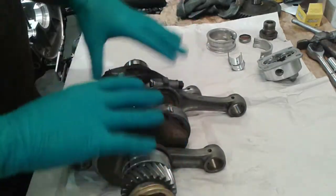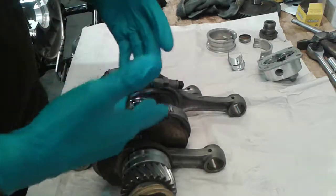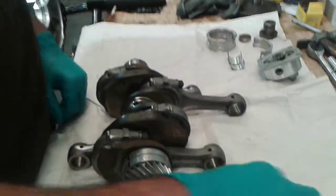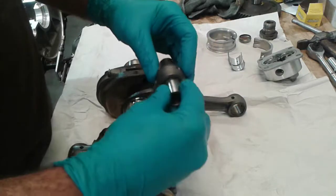After you've done all the checks, you assemble your crankshaft, put all your connecting rods in, torque them properly, and lock-tight them — in this case I did lock-tight these ones. Then you're going to check if they are straight, so you just get a piston pin like this.